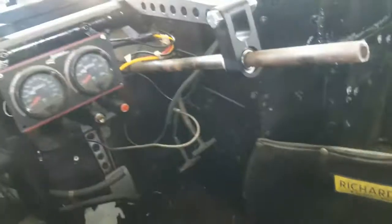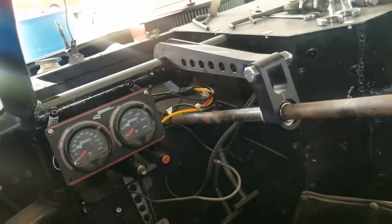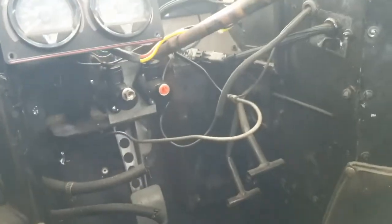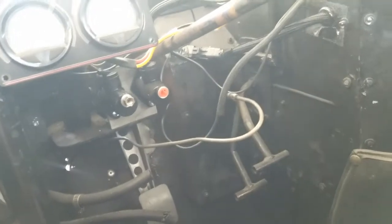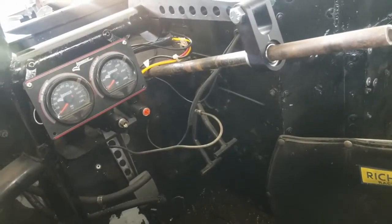Alright, back at it again. Every time we have an issue with the truck we end up tearing it all the way apart — almost seems that way. First thing was brakes. We got a couple new masters in there, some Wilwood compacts. Got one fit; the other one I gotta put the fittings in, run the lines, bleed all the old stuff out, put all new fluid in. I gotta go get some bolts for those, but they're pretty compact.